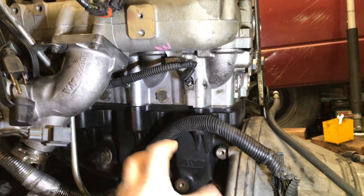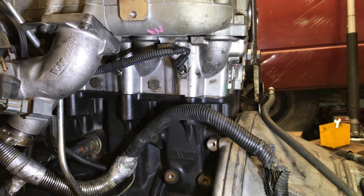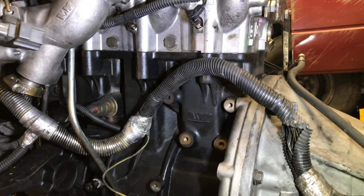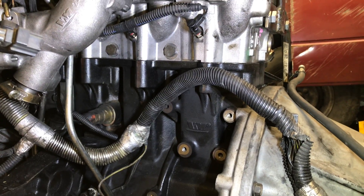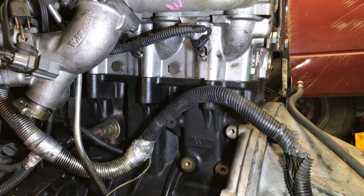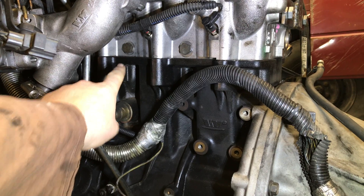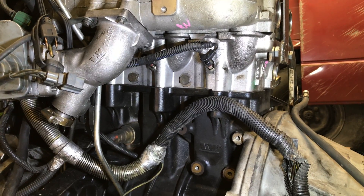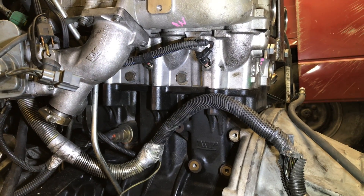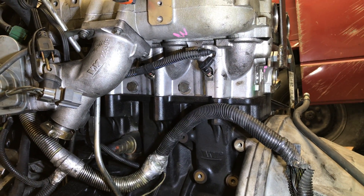This is capped now. We removed the EGR, removed all the water pipes and everything else, and we've plugged the water return. The EGR uses that water return up there. There's another one right here — these two are the same. I've gotten a spare plug from an old head and used it to plug off over there, so that's all plugged and good. You can use that existing plug to plug the other hole if you've got a spare.